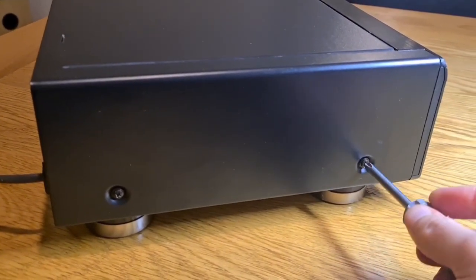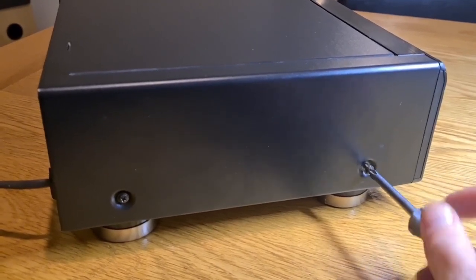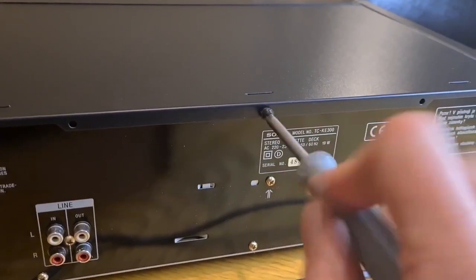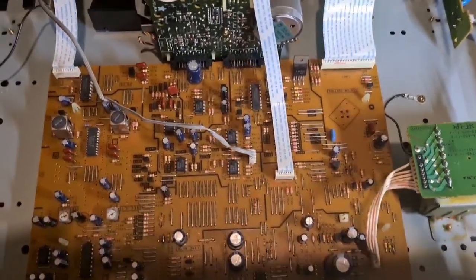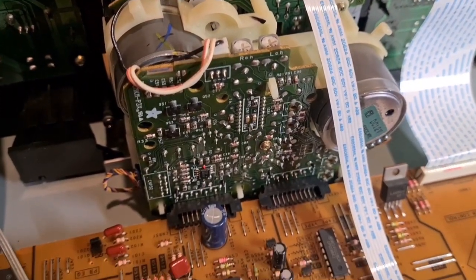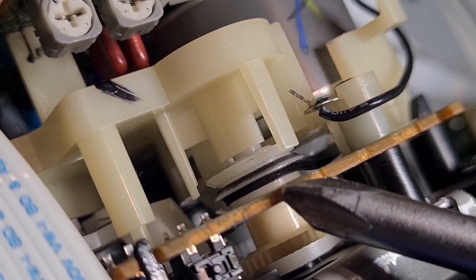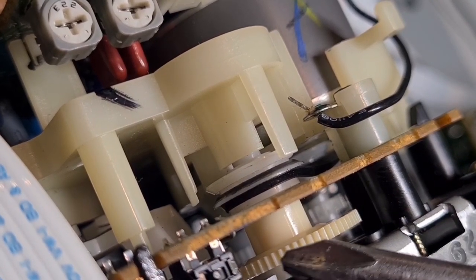Let's get inside it - standard four screws on the outside and then one right in the middle on the back, all the same screws. Once the cover's off, it's pretty clean actually, a lot cleaner than things we've had before. It's a pretty standard late 90s Sony transport - this one slides and plugs into the board, which is unusual, so you'll want to be quite careful with that. On initial inspection you can see the belt on the take-up reel looks a bit shiny and gummy.